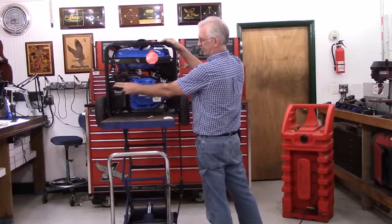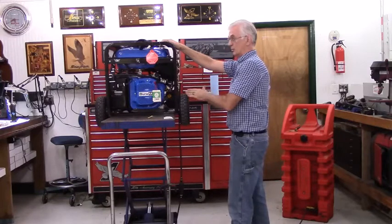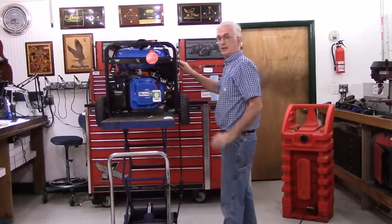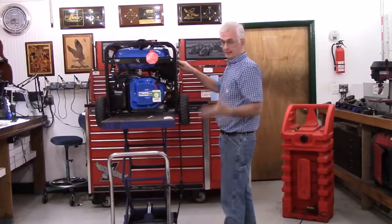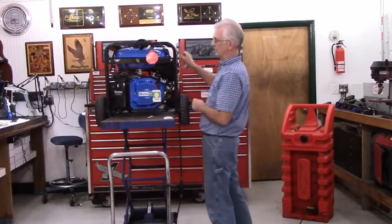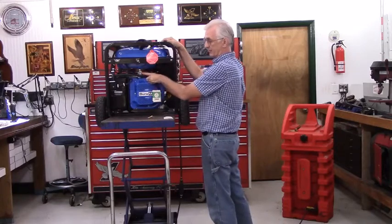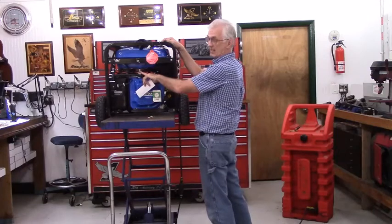My systems use a fuel pump to transfer the fuel. Now that you've got the whole thing hooked up, to start it from the remote tank, simply move the choke lever to the choke position and turn the key to start it. Once it starts to run better, go ahead and open the choke back up, then make certain the fuel selector valve is in the closed position so that it pulls fuel out of the remote tank and not the stock tank.